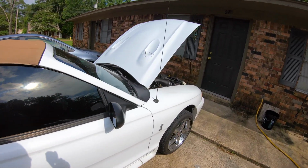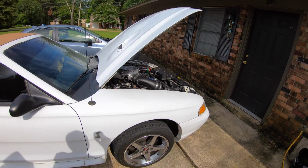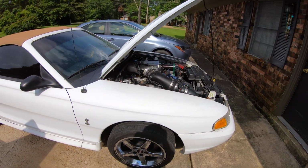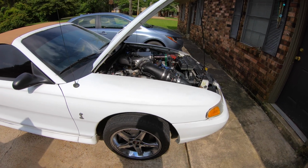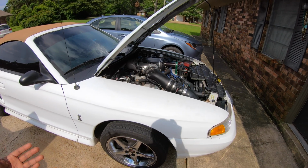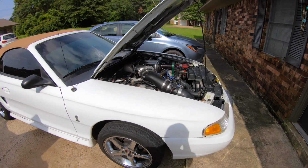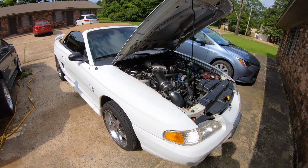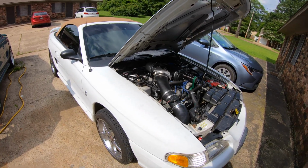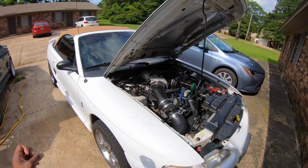You've got high slope on your fuel injectors. You've got a low slope in your injector data. You also have something called injector offsets, which is a table of voltages that relate to how those injectors fire at said various voltages. Because your voltage on your car is never at 100% stable state, there are variances based on starting, cranking, driving, low RPM, high RPM. Is the fan running? Is the AC on high or low? You have various loads. So your injectors have to be able to deliver fuel precisely at every single point in time. Now in these tunes, we make changes to the high slope and low slope, as well as the offsets.